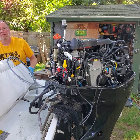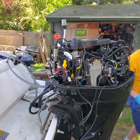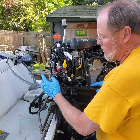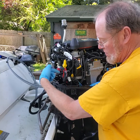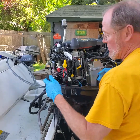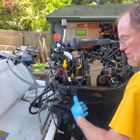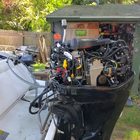With my test light grounded, key on — yes, my test light does light up. So I can hook up my starter button safely. I'm going to hook it up to the wire that is lit up when I turn the key on. That comes from the key switch and goes into the harness. I know I'm safe because I'm doing the same thing the key switch does to this circuit. My starter button is hooked up properly. When I slip the lower unit up, if the splines don't line right up, I can just bump the engine over.